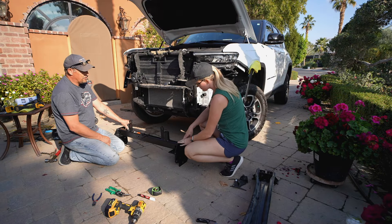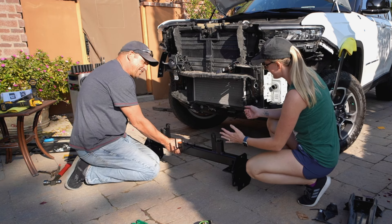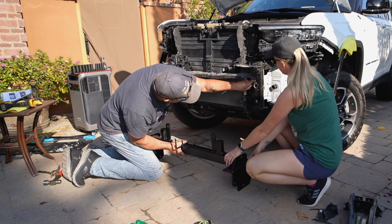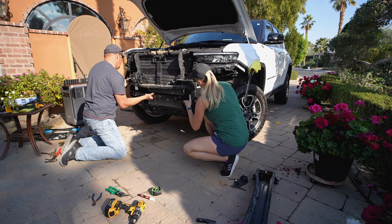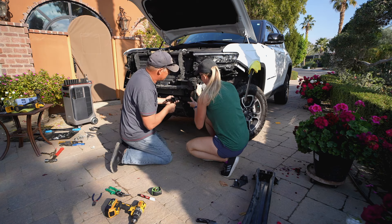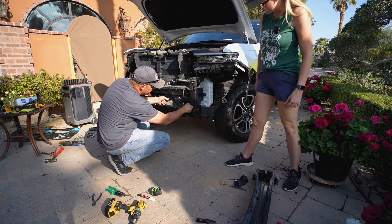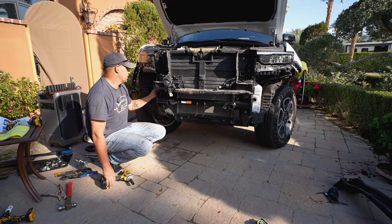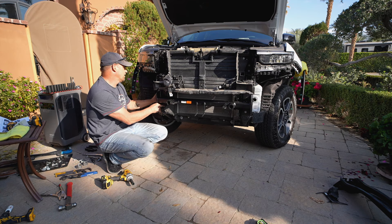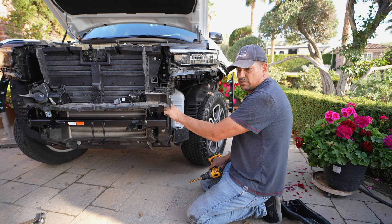So now we've got all the disassembly done — it's time to start reassembly. Once again I phoned a friend. If you can just help me lift this side up, it's going to line up right above the four there — that should slide right in. Let me get the bolt started on this side. We got those started; we're going to put all four of them in. We're not going to torque them down yet, just snug them up a little bit, and then we're going to begin to drill the side holes to mount it to the frame. So now we've got the original bumper bolts just snugged up so we can begin to drill the side holes for additional mounting of this base plate — you can begin to see how it's going to come back together.